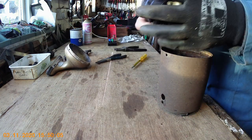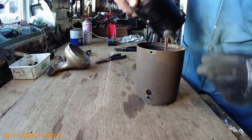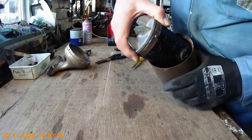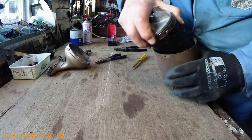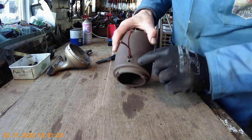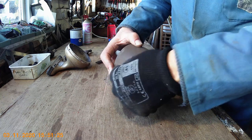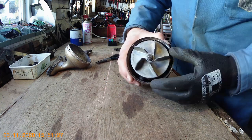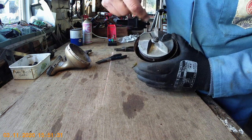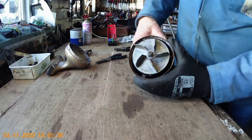So now what we're going to do is try and pop the motor in. You twist them together and should be able to poke them through that hole while you assemble it. I've got to fish this down through here without pushing the buffers out. The screw goes in there — it's the same screw that holds the handle on. I've got the wires through and I've got it in the right position. If you look now — that's very firm in there now and it's central as well, so that should hopefully solve the problem of it moving about.